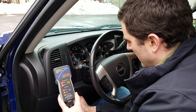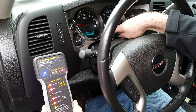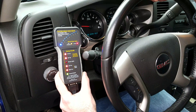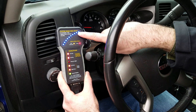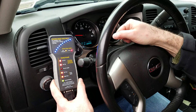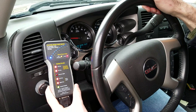One thing I wanted to try was reaction time. If I put my foot on the brake and watch on the vehicle screen, it goes up almost instantaneously. But now let's watch with the tool — I'll call out when my foot hits the floor. Foot on the floor — you can see the delay. So the truck is telling me I'm getting instantaneous power to the trailer, but there's actually a latent delay. That kind of explains a lot — it didn't feel like my brakes were grabbing right away.